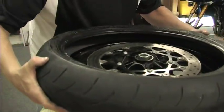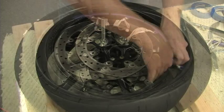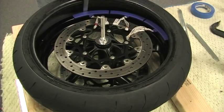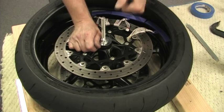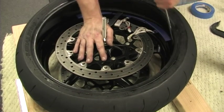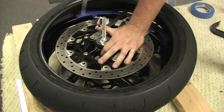Put the tire back into the mount, tightening it down, and this time we are going to install only 3 of the rim protectors, again tying them in so that they are grouped together. Now this part is really self-explanatory. I just start on one side and progress across. When I pulled the number 3 position, the first one popped loose, but going back a second time at that first position was all it took.